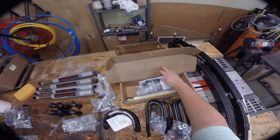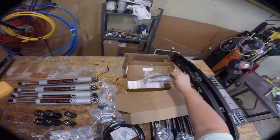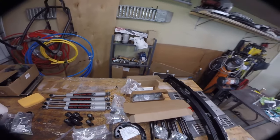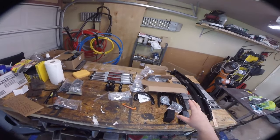In addition to that, I bought a couple of things. This is a new steering stabilizer — it was like $40, also from Rough Country. And I bought brand new stainless extended front brake lines and a rear brake line. Anytime you're doing a lift kit, the factory lines aren't going to be long enough, so unless it's a pavement princess, you really need to get longer lines.